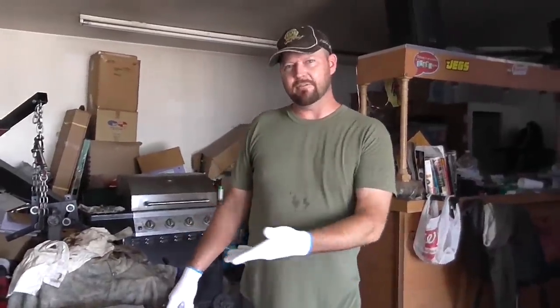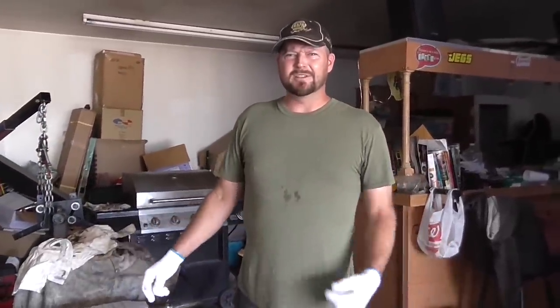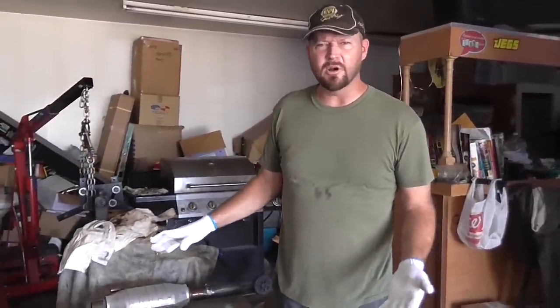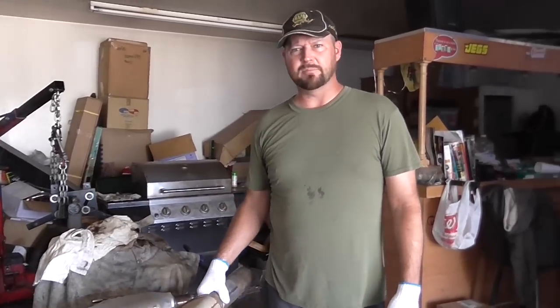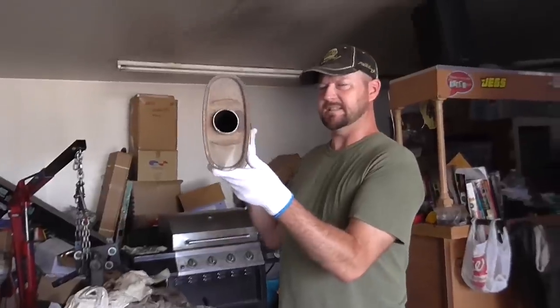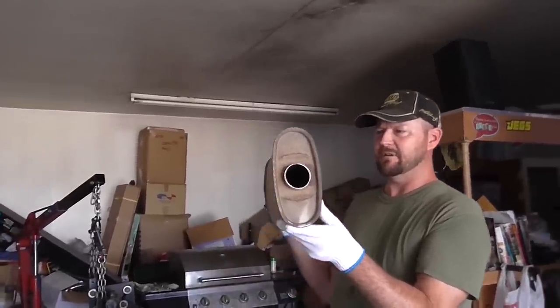I don't have a lot of stock examples because all my car's exhaust systems have been done — I'm not a fan of choking exhaust systems. I have an example here: a 2002 Dodge Caravan which has two mufflers on it, because one isn't enough. Two big, huge choking mufflers. Can you imagine how hard it is to expel the gases from a hungry V6, a hungry straight six, or a hungry four-cylinder turbo? We happen to have an example here today. This is an exhaust that came off a 260Z, and as you can see inside, it's very restrictive.